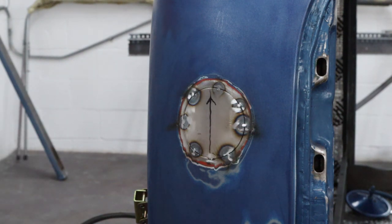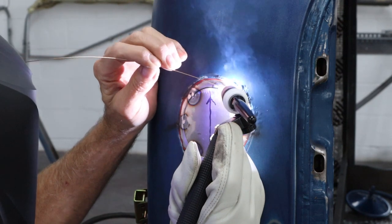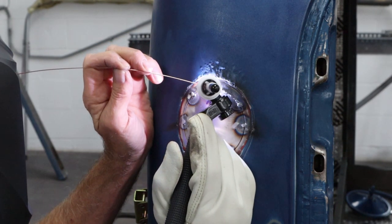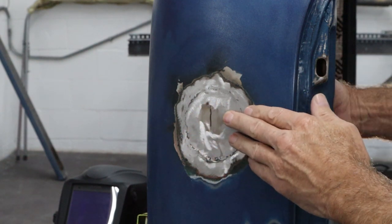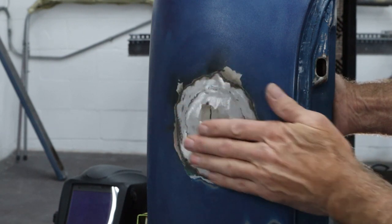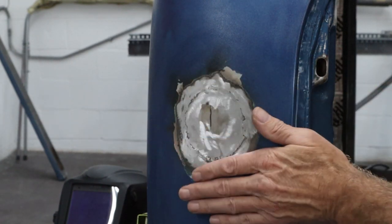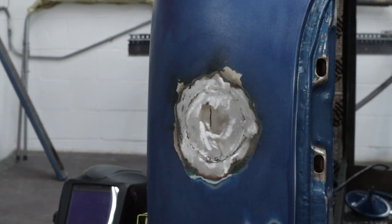I'm no TIG welder, but I'll do my best. Got it welded up. I ground the lip on the inside completely flat, then hammered and dollied the weld - first ground the tops off, then hammer and dolly, then dollied it out. The shape is really nice. Checked it with the profile gauge - not perfect, but looks pretty good all along there. It's a little low but pretty consistent, riding up on the thickness of the paint. Running the straight edge the other way it looks pretty good too. Pretty happy with the way that came out.